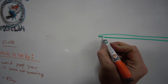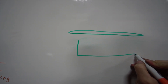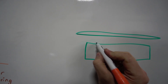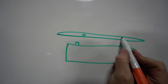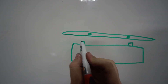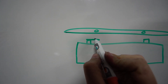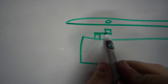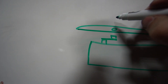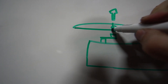Using OEM holes is kind of cool. So we have our intercooler right here with two threaded nubs, and on the radiator support we have two circles. If this works, I'm thinking we'll get a flat piece of steel just like this, and I'm going to weld a nut on it right here. The nut is going to make up not only for the height difference, but it'll give us threads on the inside to actually put a bolt right into it. Easy peasy.